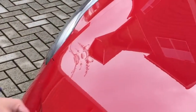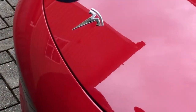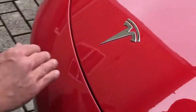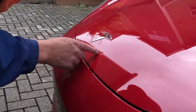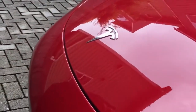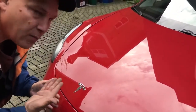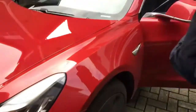Let me drop this hood — how do you drop a Tesla? We got it as much as we could with the glue pulling system. The nice thing is that we didn't break any of that paint off. It does look like it has a little fracture in the clear coat. I got to the point where it wasn't lifting and felt like it was wanting to pull the paint more than the metal, so I stopped. Sketchy.